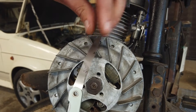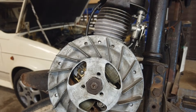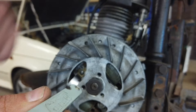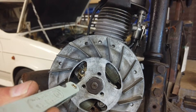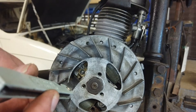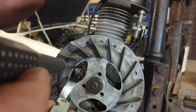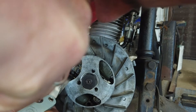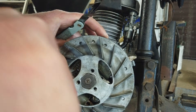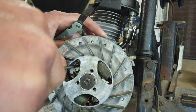I actually stopped smoking since setting points last time, so I'm going to use a feeler gauge at 0.02 - that's really thin - and I'm going to set the points. Right now it's stuck in between the points. Then I'm going to move the points to the rupture point. Now I'm going to turn the cam in there until it releases. That's right about there, and I'm going to tighten up these. That's the way I have been doing it in the past.